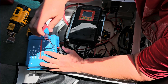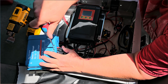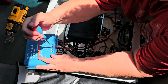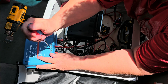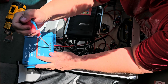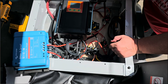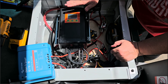So now we basically have the Victron chassis battery charger installed — completely wired, ready to work. The next thing I will do is mount it to the wall. I'm probably just going to use a couple of self-tapping screws. I'm going to use some tough self-tapping screws, and then we'll be able to close these breakers and it will come to life and we'll do the settings on the phone. Then Jane and John can be on their way.